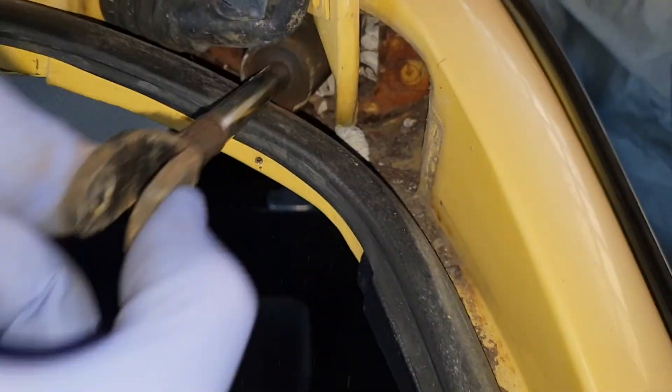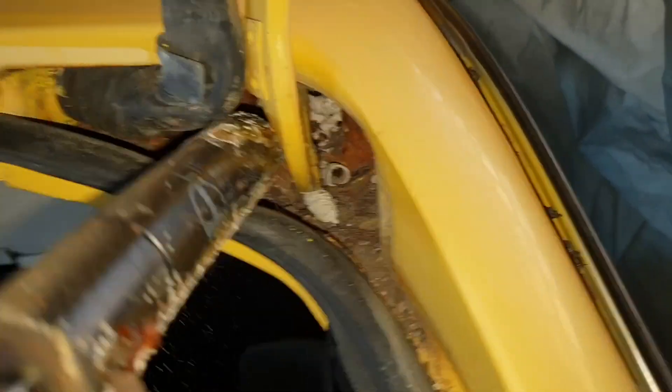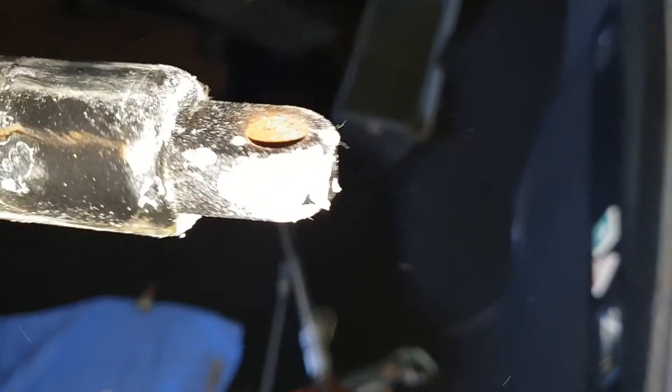On one side I was lucky to get the Allen bolt out as they were very, very stubborn. I think these were the original set and I stripped these quite badly, but one was able to be extracted. The strut can then be removed. You can see the poor state of this one and a further hornets nest on the driver's side.